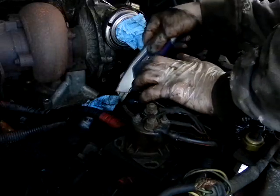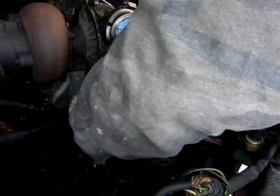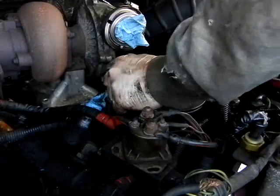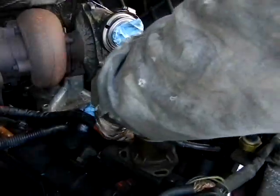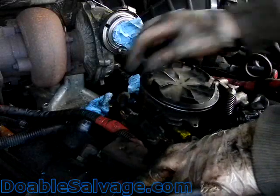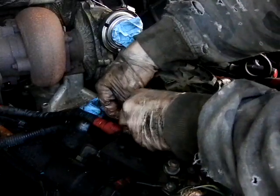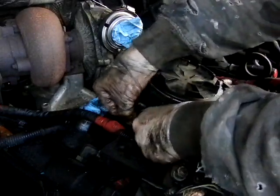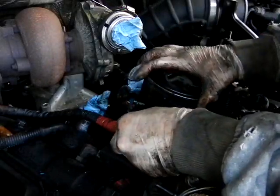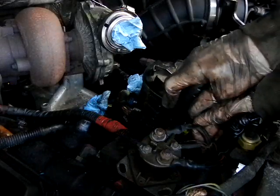You'll need to go down there at the bottom and cut that one hose that connects the fuel pump to the fuel bowl. It's a pain to see and get to. I got a wiring harness right here to worry about, and I'll show you what to do with it in a minute, but in the meanwhile, just go ahead and unclip it. Oh yeah, you also need to undo the drain tube. It's right down here.